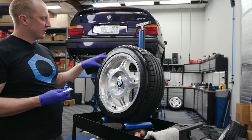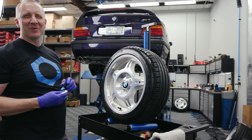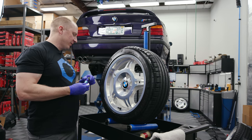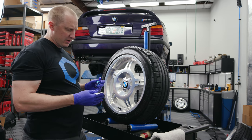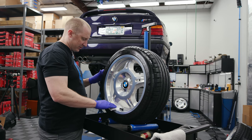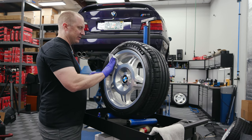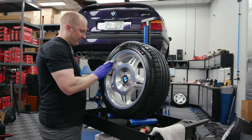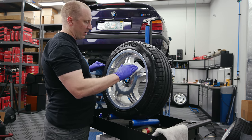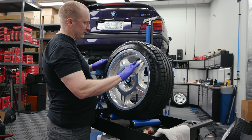Last step on the wheels: I put a second coat of Deluxe on this morning around 11:30, and I'm going to top it with Gliss — it's been curing for four or five hours now. What you'll notice when you put the top coat on is it goes on much slicker — see how there's no grab or anything like that. It wipes off easier too. I'm following the same procedure: doing the face of the wheel, staying organized, hitting all the cracks and crevices, then wiping it off, and then doing the barrel of the wheel.